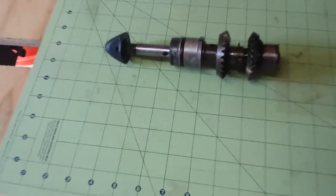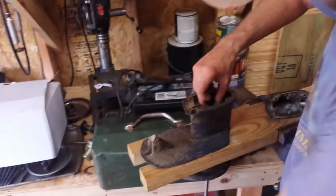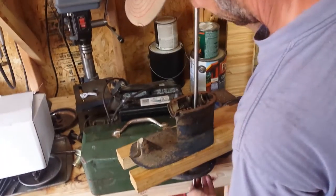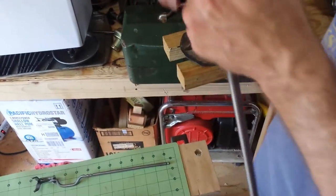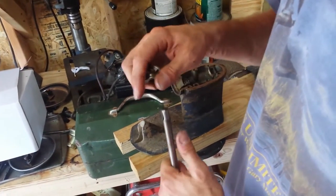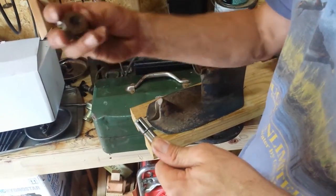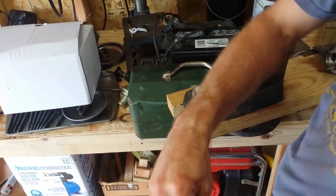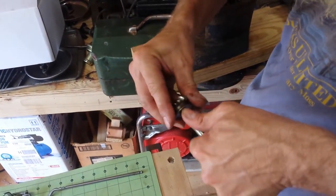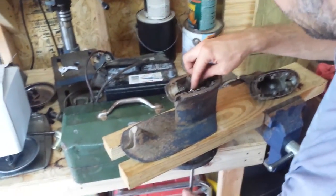I've just pulled the shift rod out — it fits down a small hole there. Here's the drive shaft with the pinion gear. The pinion gear fits down through the lower unit housing. If you were to pull the drive shaft from the other side, the pinion gear will just slide right off — it's keyed in with a woodruff key into the drive shaft. You can see the slot in the pinion gear. I'll go ahead and put it back together and stick it back into the gear case housing.